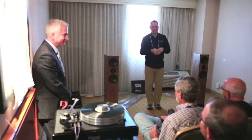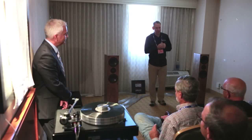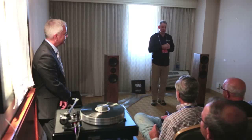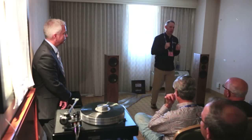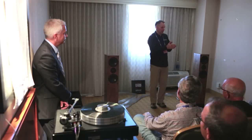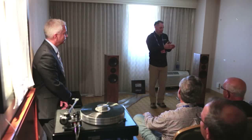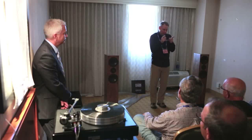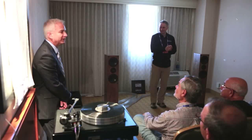So, like I say, the first thing is it makes a difference. And the second thing is that part of that difference depends on the records you own and the records that you prefer to play. So, for instance, in Britain, Decca aficionados really like the Stevenson curve, because Decca tended to have very wide cuts, and they run right in close to the label. So the width of the cut surface on the record tends to be very wide on a Decca. So obviously, where you're placing the null points matters. Yeah, so on Stevenson, the second null point is at the run-out groove.